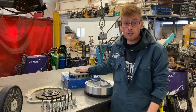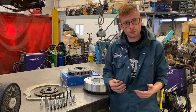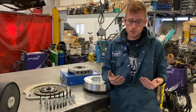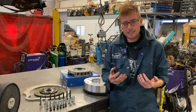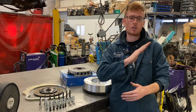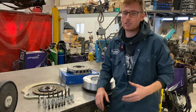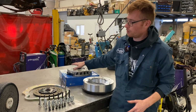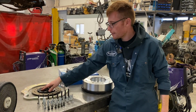And all you're going to end up with is something that you can't drive on the road. Well, you won't comfortably drive it on the road. As you're trying to let your clutch out, it'll literally be grabbing. You won't have that bite point. You won't be able to hold it on a hill. It'll be on its way trying to go. So cheap clutches are just crap. Go for something strong, then you can use a normal drive plate, which actually drives like a normal car.